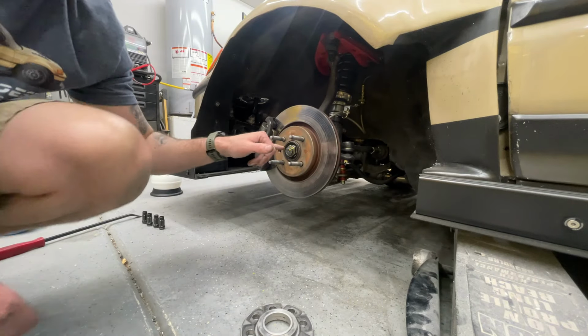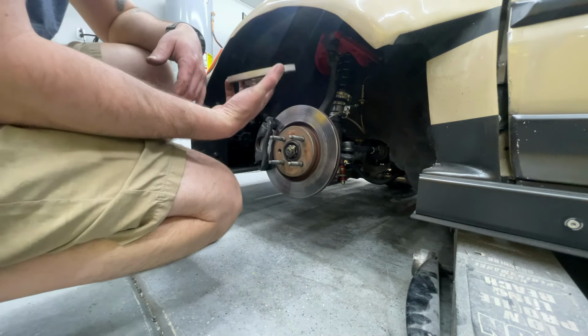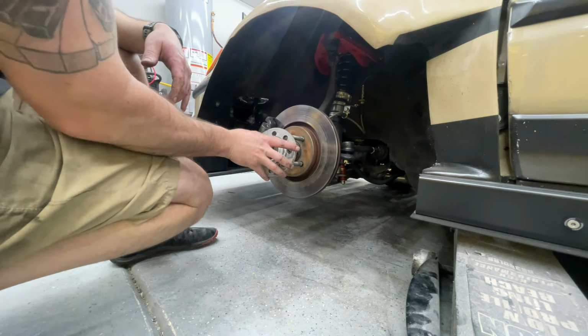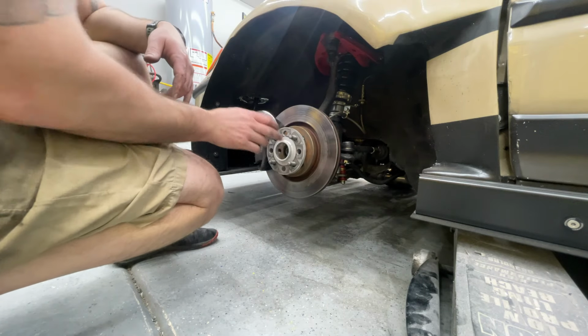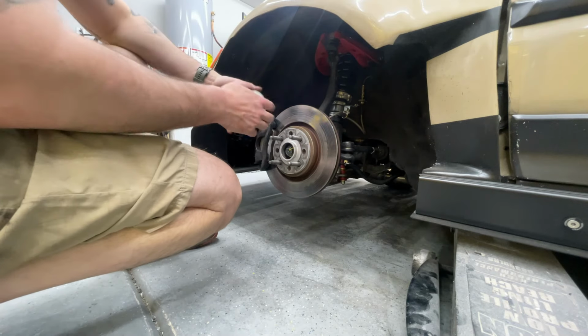All right, I staked the living crap out of that, torqued it, blue Loctite, just bled it. I'm running these H&R 10 mil spacers for anybody that is curious. I could probably get away with 8, but they didn't sell an 8 that I could find, and the 10 has been fine. And then my hub ring.